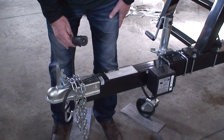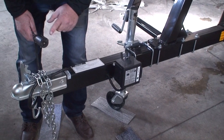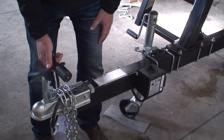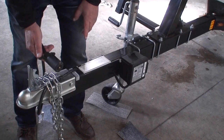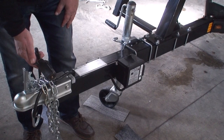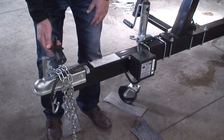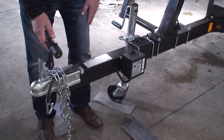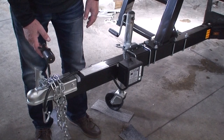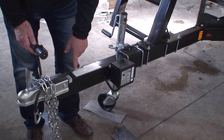This trailer has electric brakes. This is the actuator for the electric brakes. Most electric brakes are going to come with the round plug-in — this is a camper style plug-in that you probably have in the back of your vehicle. If this were hydraulic surge brakes, you probably have the flat five, and the fifth wire is designed so that when you put your vehicle in reverse, that fifth wire gets 12 volts and engages a solenoid inside the tongue that prevents the brakes from engaging as you're backing up a hill. Without it, the brakes will lock up if you're trying to back up a hill with hydraulic brakes.